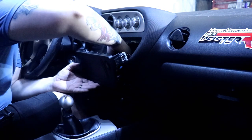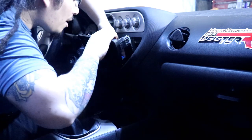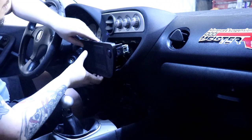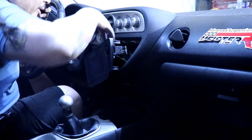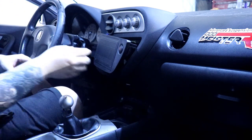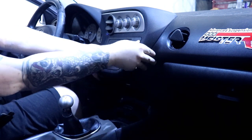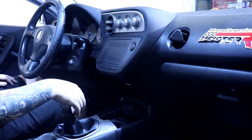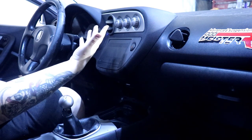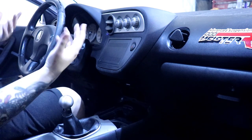The radio harness probably won't reach all the way over, so I'll just put it in now. And that's it — that's really it. Where this panel connects to the double din, I just put a bunch of gasket maker to basically glue it in. So yeah, that's pretty much it right there — radio delete done.